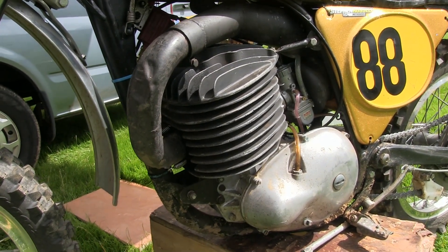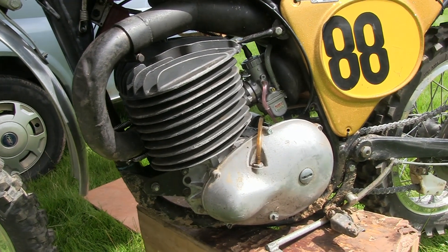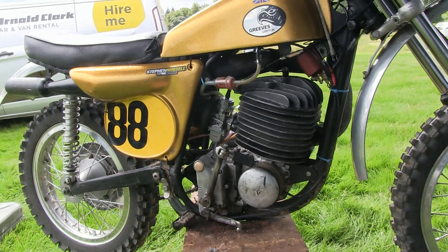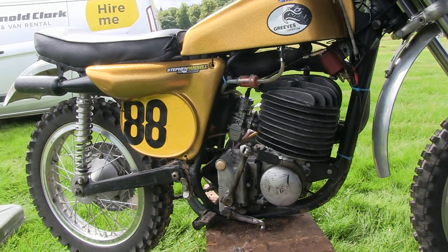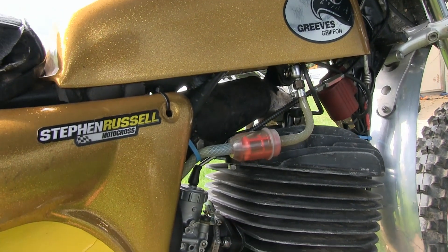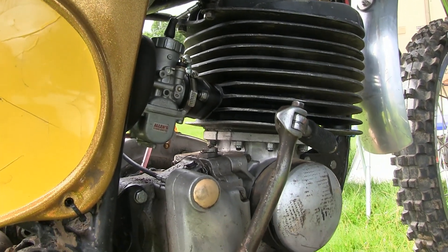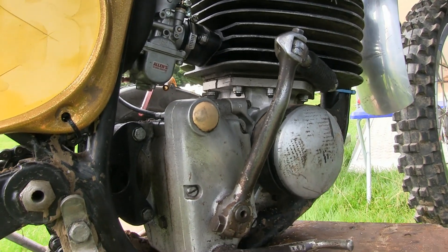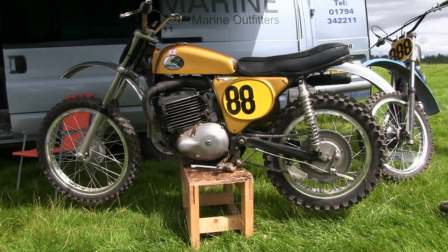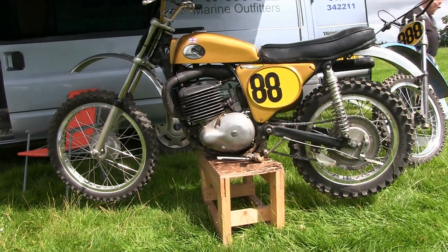The Griffin motors were decent power plants in their day, and it's said that the oversized barrel fins on the motor were designed to improve cooling when these bikes were shipped to the USA for desert racing. Normally these Griffins had a four-speed gearbox and an all-metal clutch, putting out about 39 horsepower — not too bad for a 1970s British motocross bike. The ignition system was a kind of electronic energy transfer type, and by all accounts was reasonably reliable. When set up right with regards to suspension and engine settings, these could be a very competitive package for a good club rider.